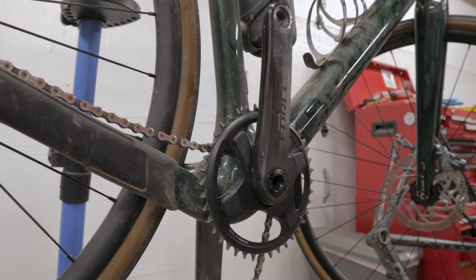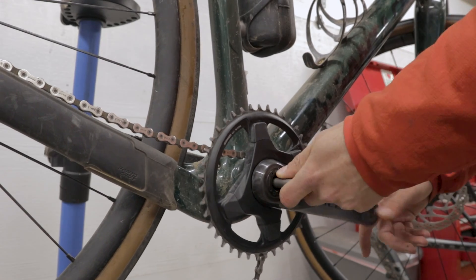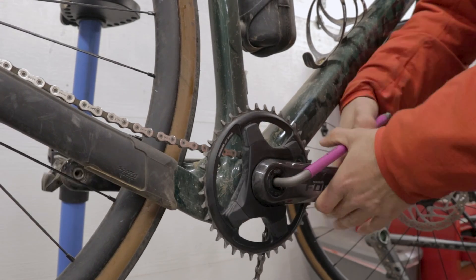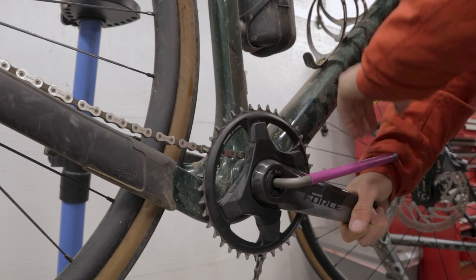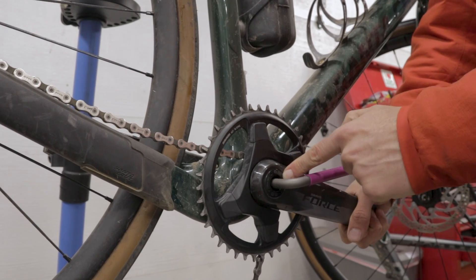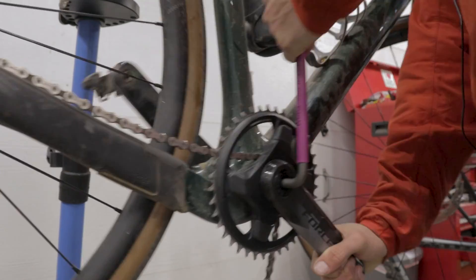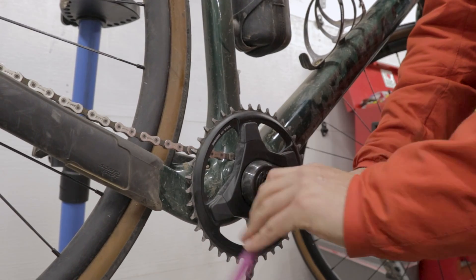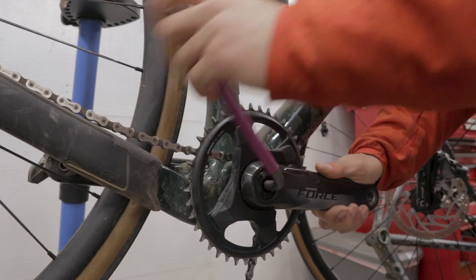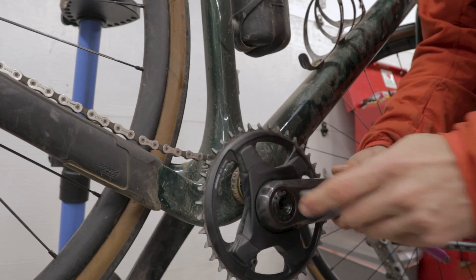At the front of the bike the chain is now slack, so I'm just going to pull it off the chain ring and put it down behind. To remove these SRAM cranksets they use a captured bolt — it's sort of like a built-in crank puller. There's a bolt inside which you tighten to attach the crankset, but when you loosen it, it pushes against the outside cover and pulls the entire crankset off. It'll go loose, meet some resistance, then go loose again as it pops off.